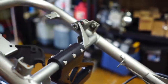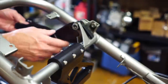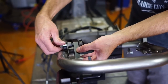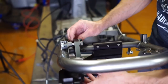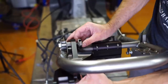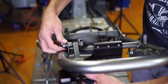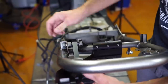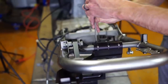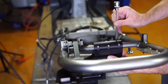I've got that mount on there, and then this is the old shock mount, so I'm just going to place it like that. Here's your original shock bolt — you'll be using that. Notice that there's a lot of play back and forth. Once you get your adjustment correct, you're going to want to fill these up with spacers or washers. This mount is completely adjustable — you can move it to the left, to the right, back and forward to get the perfect stance.